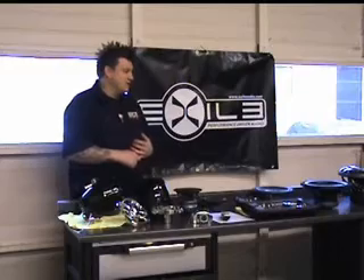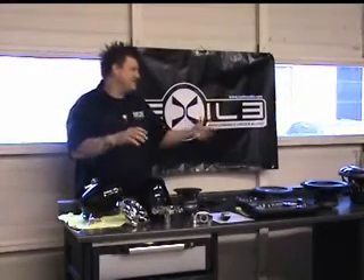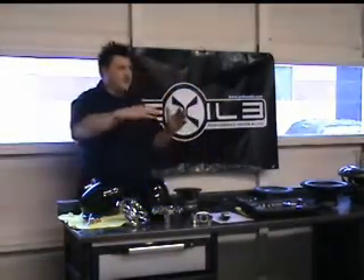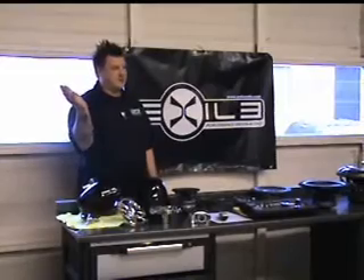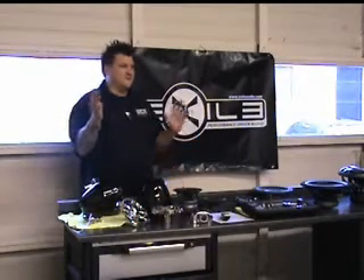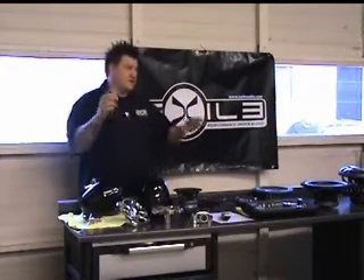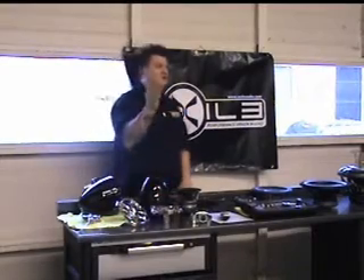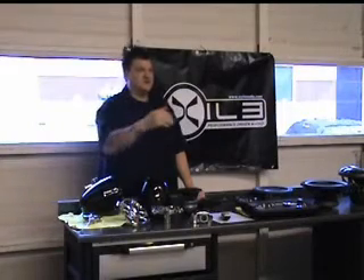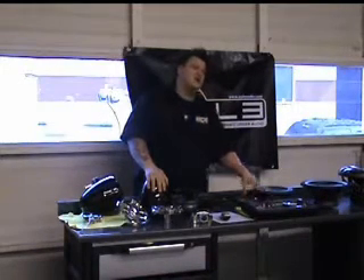Dynamic headroom — you've basically got two levels. The easiest way to explain it: if you've got a deck and you've set it up so you have to turn it all the way up with the gain all the way up to get max power, you've not reached the potential of getting the most out of that speaker — you've underpowered the speaker from the head unit all the way down. Any radio will clip. You want to be at about three-quarters volume so you don't clip the signal, because once you start clipping, the amplifier feeds that clipped signal and clips as well, giving you distorted output.